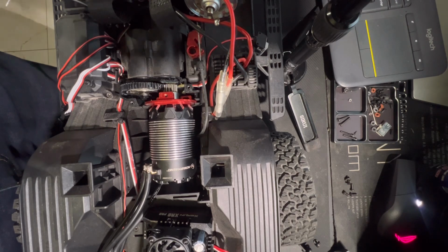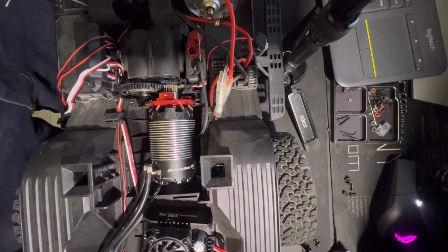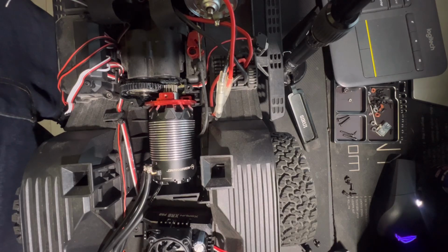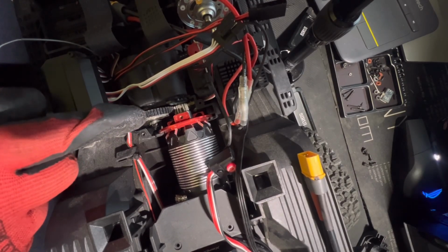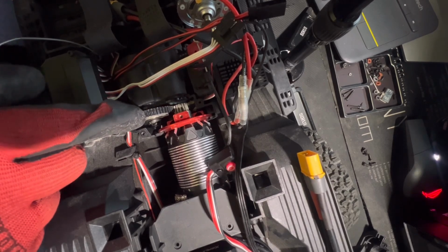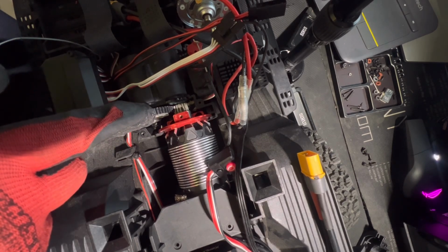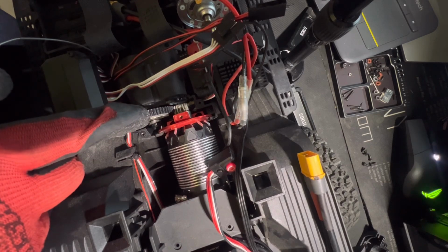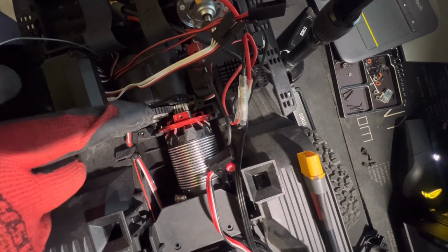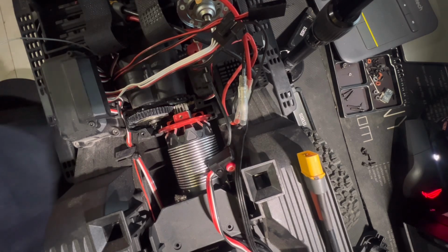The tricky part is actually getting this mesh just right. So you don't want it too tight, you don't want it too loose. And usually the manufacturer's mesh is perfect, and hopefully we can get that. I actually use sound sometimes to mesh the gears, because sometimes using paper you don't get it exactly right. Sometimes you press the paper a bit too hard, so it's always good to listen to the meshing that the manufacturer sets and copy that meshing. So we've got the spur gear and the pinion perfectly aligned. Now we're going to connect this system up.